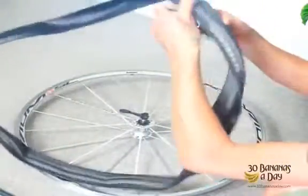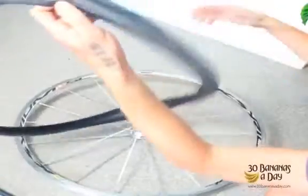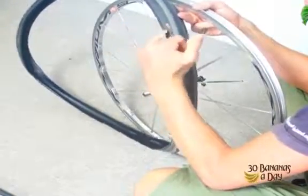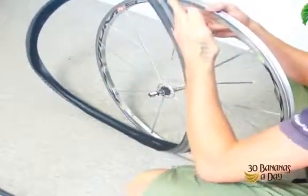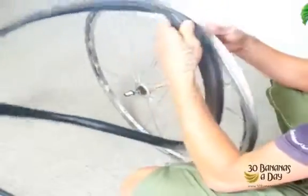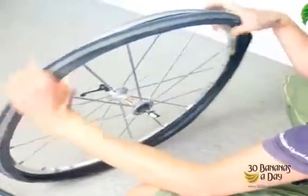So we're going to put the tyre on first. And what we do is we start at the brand when we put that on the eyelet. Because this is a unidirectional tyre, it has the brand on both sides. If it's a directional tyre, with directional tread, it will have the pattern only on the one side, on the right. So we put that on near the valve.